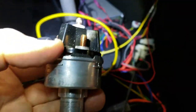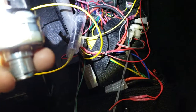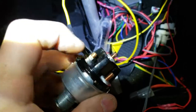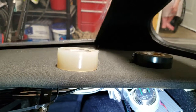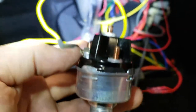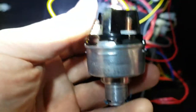So that's essentially how you do it. If you have any questions, please ask me directly. Don't mess with this if you don't know what you're doing, because it is a 48-volt system and you could cause yourself problems. When you're playing with this switch, do not hold it and turn the key on, because it does spark. I'm actually going to be wrapping it with electrical tape — some black electrical tape and some clear electrical tape — and then I'm going to get some gorilla tape, the wide stuff, and wrap once with that as well. I don't want anybody touching this and getting a shock. 48 volts running through your body won't kill you, but you're going to hurt — it'll give you a new hairdo.